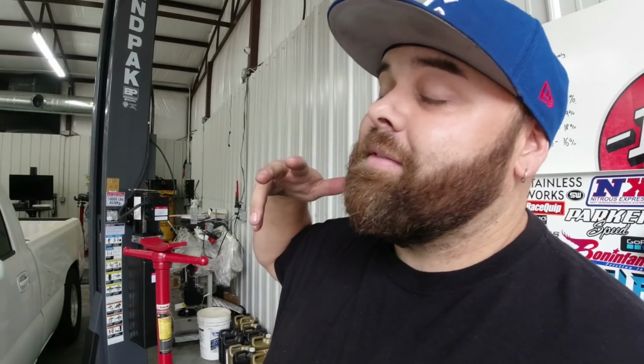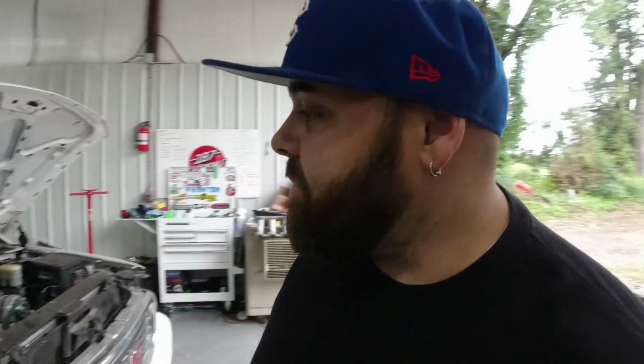That motor was 5 years old. It had been beaten mercilessly for those 5 years. And then I wasn't any easier on it, because I started spraying it pretty much every day. So I blew that motor up and I had to build a new one. The crank was trashed, unfortunately, so I went with a stock crank with an LS2 block. The block was already 30 over, come to find out when I got it. So I built a 370 cubic inch.